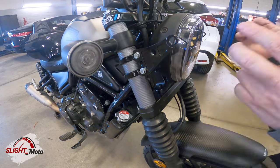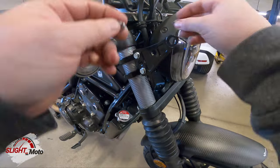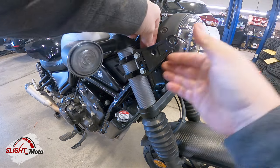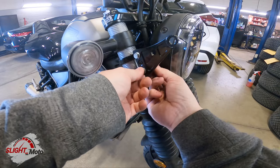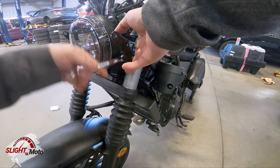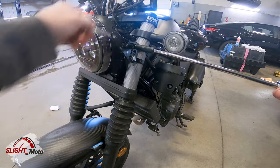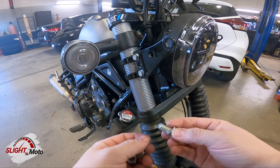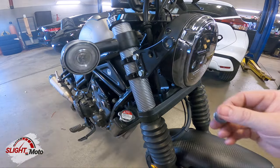We're facing them out straight — just checking the measurement again. For added safety, we're going to put a washer, lock washer, and nut on the other side, and just tighten that down. With those holes, I'll put all the specs in the description. The washer, lock washer, and nut on this side is what's going to hold the fairing.